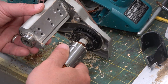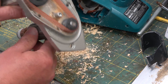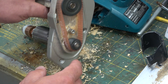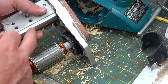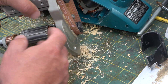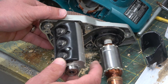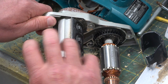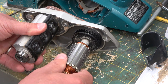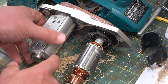Now, very likely you'll let the smoke out of her because you'll get less cooling, the insulation will cook off, it'll fail, and then the magic blue smoke — what doesn't get back in. The other failure you might get is if you stall this — there is not a whole lot of torque that can be throughput through that rubber band. It's about 2 to 1, so if this is running at 17,000 RPMs on the cutting head, then this has got to be running at 32,000. What they're relying on to not stall out is the inertia of this rotating mass to actually cut and not stop, because there's not a whole lot of torque actually being transmitted here — certainly not enough torque on its own to cut a big sliver of wood.